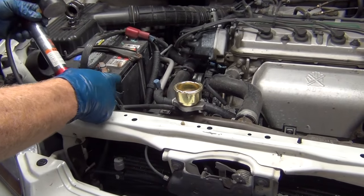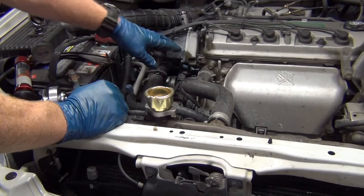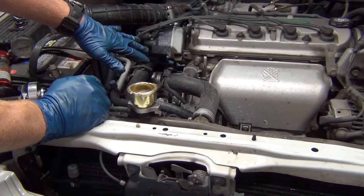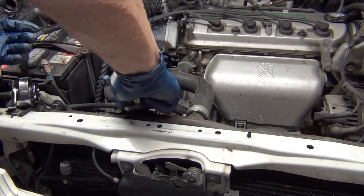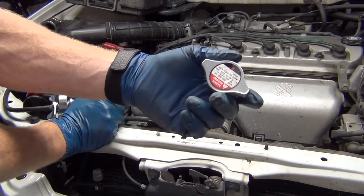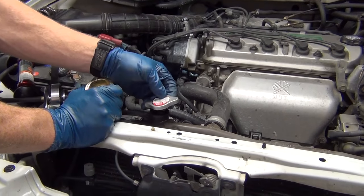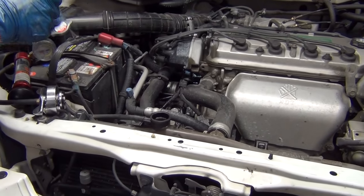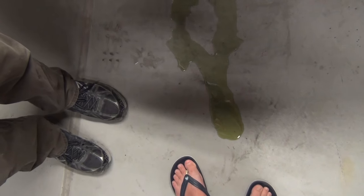Really awesome tool — I'll do a link in the description. But remember, if it's leaked down to where there's no coolant in the system, then you don't have any coolant to trace to find the leak. So step number one: fill up the radiator. Look for something that looks like this — whether it's here or there, you just fill it up and check for where the coolant comes out. Make sure to use a drain pan or you'll have this all over your floor.